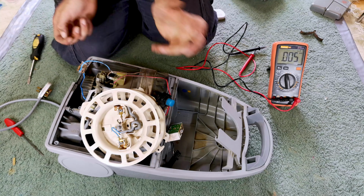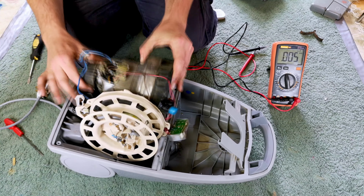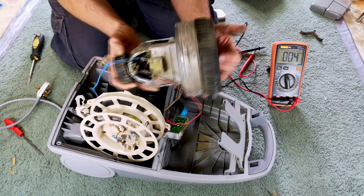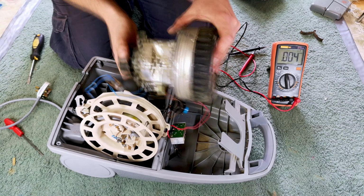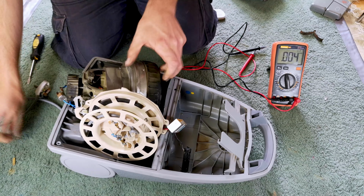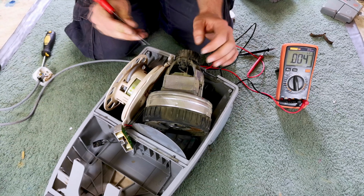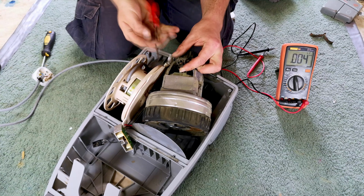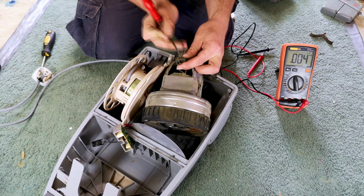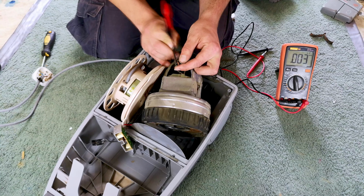So I'm going to do that first, because everything else seems okay. The motor spins fine, doesn't seem burnt out. I suppose we could also check the carbon brushes, couldn't we? Where's a good place for you to see me take these out? Yeah, whole thing's pretty manky. We should give it at least a good blowout, good airline before we put it back together.